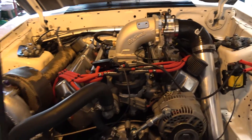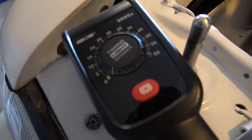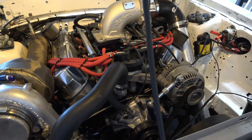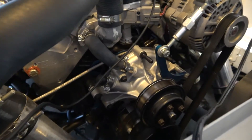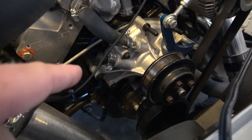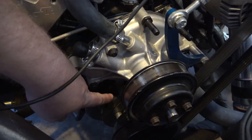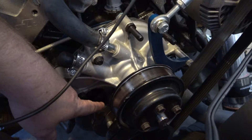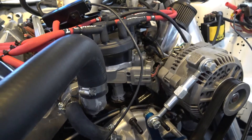You can start the car and use your timing light. Make sure you have it set on zero. We're going to lock out the timing, so we're going to say zero degrees on your timing light. When we start the car, we want that pointer — it's hard to see, but that pointer right here — to verify timing on your balancer. You want that pointer to show 30 degrees on your balancer.